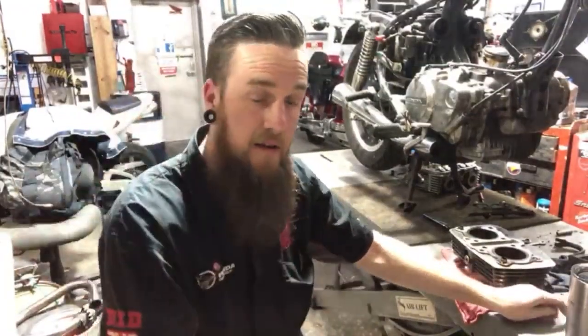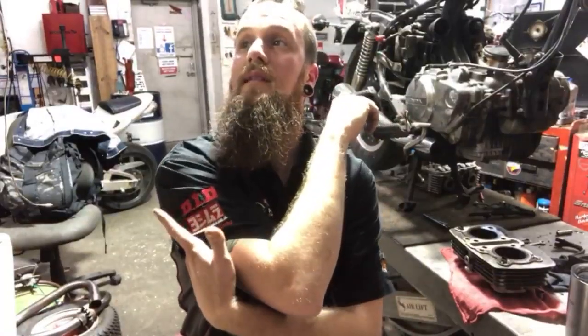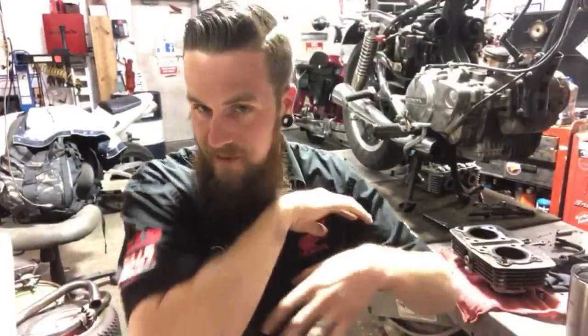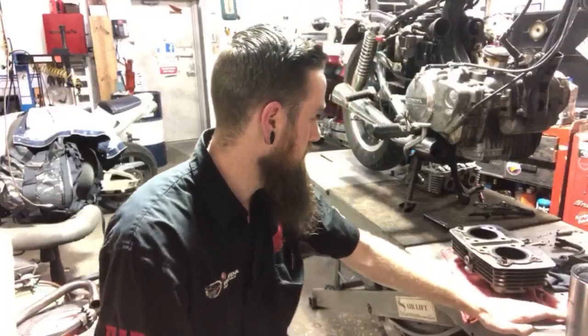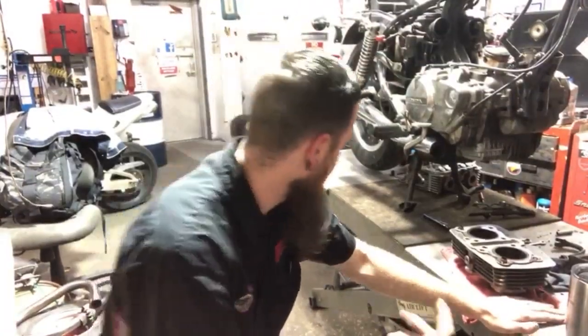Yeah, or lean, yeah. Whoever just said that, who said that? Carrie, I've seen this many times with outboards with carbs leaned out on one cylinder. Absolutely, leaning that cylinder out, it gets extremely hot inside of there, because people don't realize that fuel actually helps cool things down. But it could, yeah. Let's look at the head real quick.